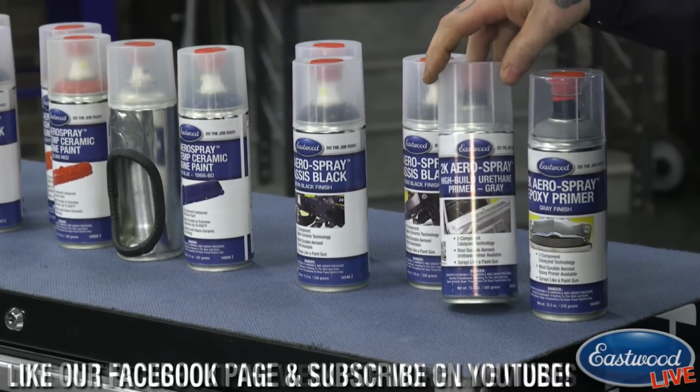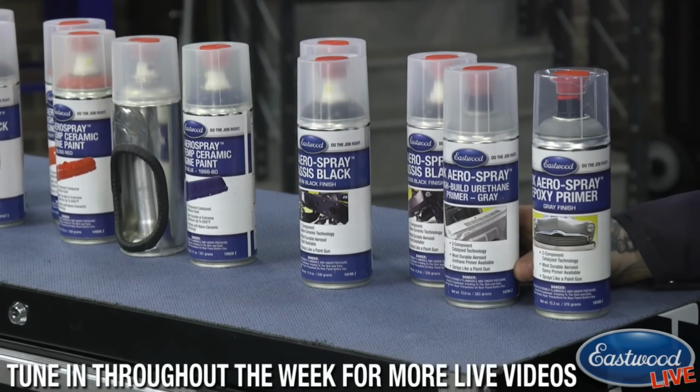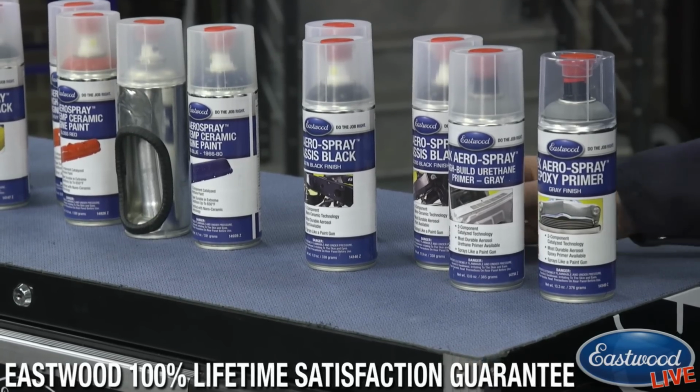We also have a high build urethane primer. So if you want to block sand and get a laser straight finish, you can use this to apply down for a high build primer, and you can block sand it out.